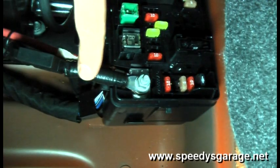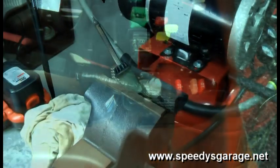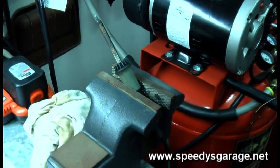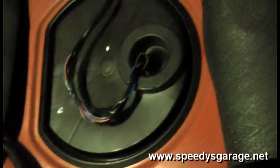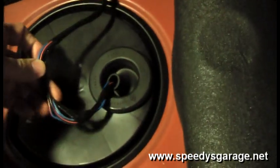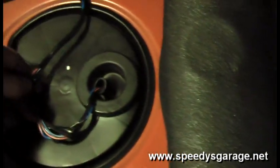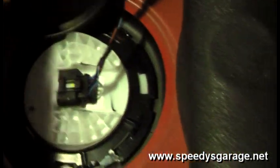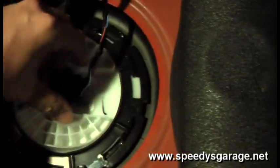This is what will give our fuel pumps power. The next steps require some soldering, so plug in your soldering iron to let it heat up. This is the OEM wire bundle that controls the fuel system. We're going to unplug this connector off the top of the fuel hat — here's the lock ring that holds the fuel hat down, we'll remove that later. Just push down that tab and unplug the connector.